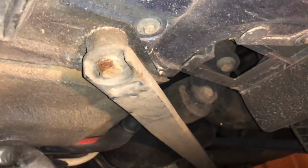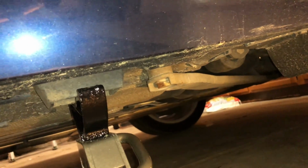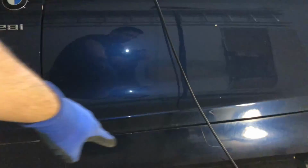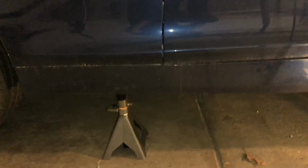Some of the other lifting points could be this right here on this car, but I couldn't get the jack close enough to where I could get the jack stand and the jack in the same space and lift it safely this high up in the air, so I could put the jack stands in. So I chose to do it with a long board down the bottom of the car, lift it up, and put both jack stands underneath.